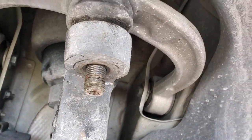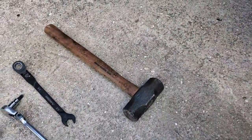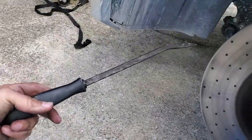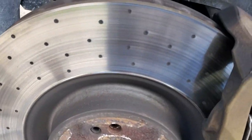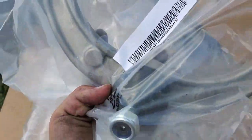The nut is off but it's not moving — you're gonna have to hit it with a hammer. I have my trusty hammer and a small pry bar. When you put the new one back on you'll probably need the pry bar to get it to go on properly. I opened the new control arm to make sure it's correct — everything looks good, it has the hole in it for the air ride level sensor.